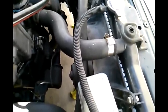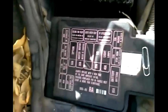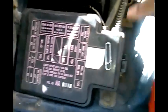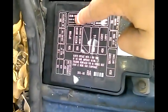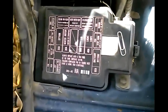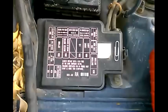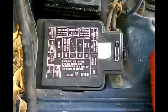In the previous video I showed you how to check your radiator fan and your cooling fan relay using the paper clip method by turning your ignition once. If your radiator fan turned on, that meant your fan was obviously working and that your relay is working, because without the relay the fan wouldn't turn on.